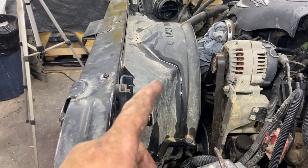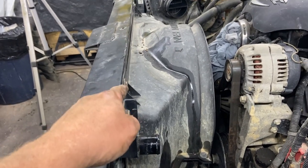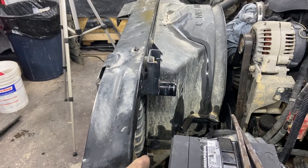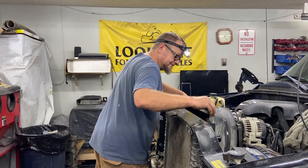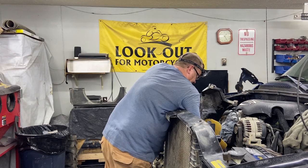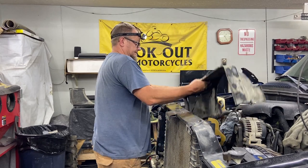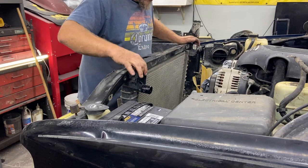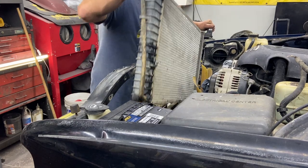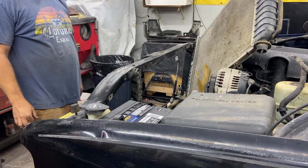Time to take another leak — time for the radiator shroud. Got some plastic clips holding the two pieces together and then a couple of 10s up here, and that top piece should come off. Then we should be able to fish out the bottom piece after we unbolt it. A couple of 13s up on top here and this will come right out. Let that drain for a bit.